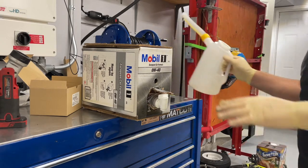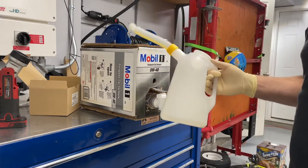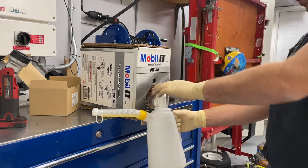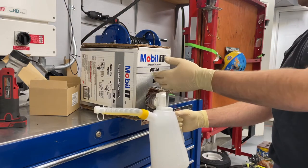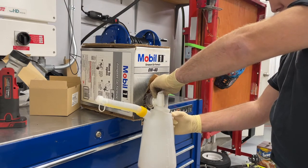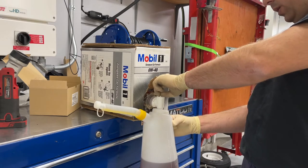Time to fill the oil. What's nice about this Mobil 1 12-quart box is it comes with a nice little spigot. With the can to fill it up you can measure it out. The Cayman requires about 7.2 to 7.5 quarts — or liters — of oil, depending on how much you let it drain. We'll go ahead and fill it up in 2-liter increments. Open the spout, let it fill up, put it in, and rinse and repeat.